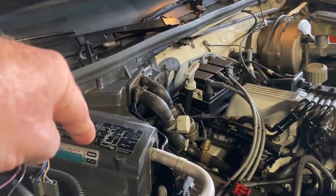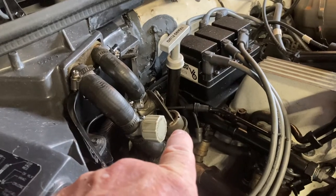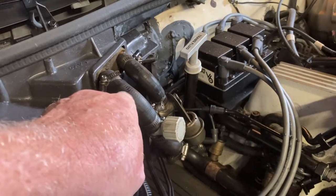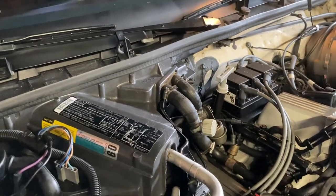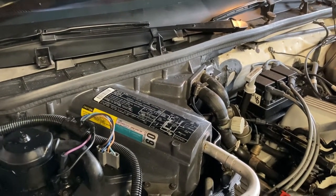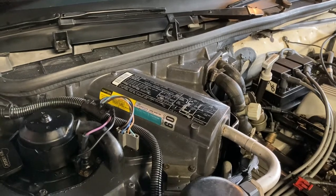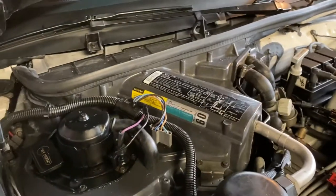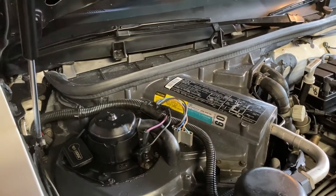In between, some of the insignificant things: when you call up a maximum cold command, you energize the water control valve, and you get another degree more cool because we're shutting off all hot water. So we reduce the thermal in this box and make life a little bit happier. This was called, I believe, C60, and we had C65, and then the buzzer, we called them, the C68, where every time you hit a control, they'd have to rehome. The electronic touch control. Damn, those were bad. Fortunately, this one wasn't equipped with that. They're all in play, but all pretty much the same housings.